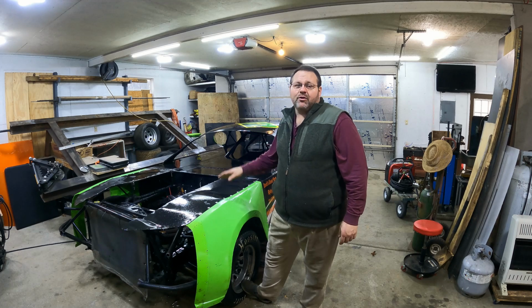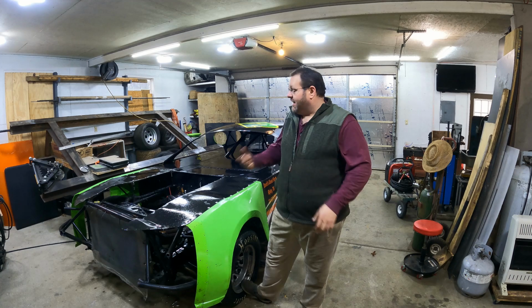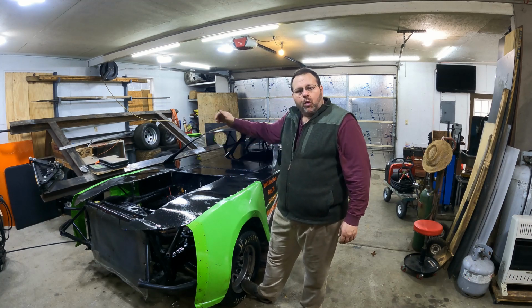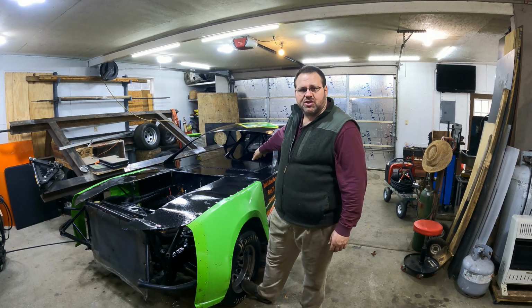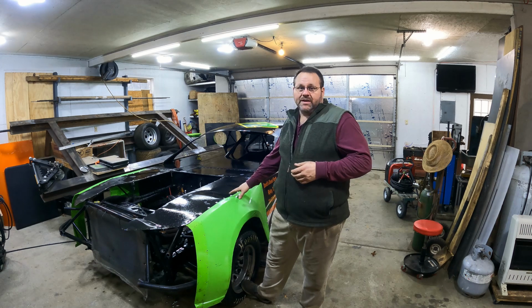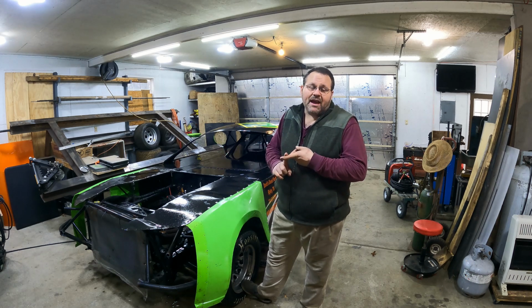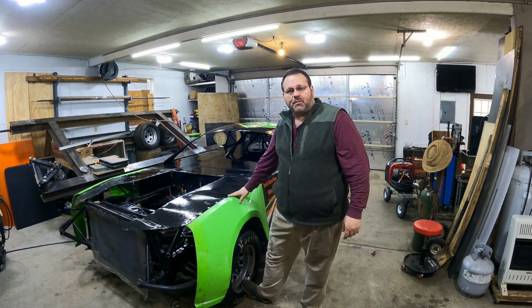We're going to go back through, show setup, show scaling. We're going to square the car. Next video is coming up on this one. I'm going to take the control arms off. We'll go through them from a maintenance standpoint. We're going to check the rear end, make sure it's still square, the leaf springs on the back, all that kind of stuff. That's all coming up immediately on this car. Then we're going to put the engine and transmission back in it, put it on the scales, and show every bit of that the whole way along on the leaf spring car.